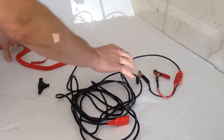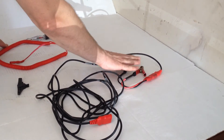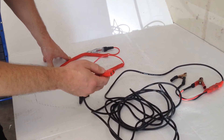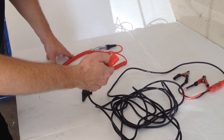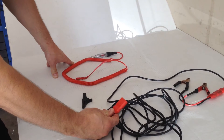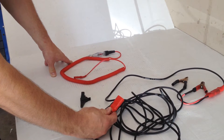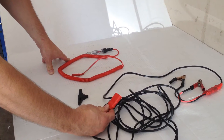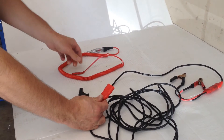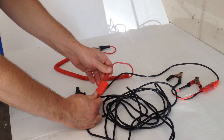So now what I do, I plug in a power probe extension cord to a battery positive and negative terminal. And now at the other end, I'm going to have full access to a ground, positive, and negative terminal of the battery. So many times when you walk up to a car, you're going to have a hard time finding a good ground underneath a rusty car or maybe in the trunk area. So now with this, you will be able to have access to your ground and to the power.